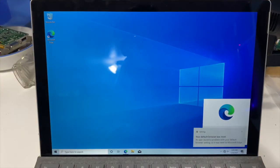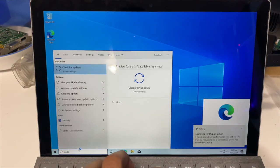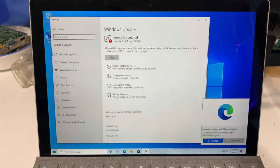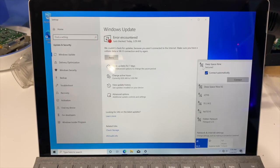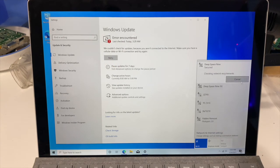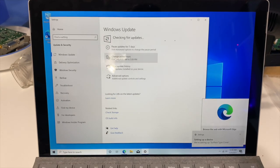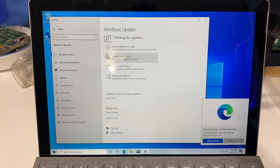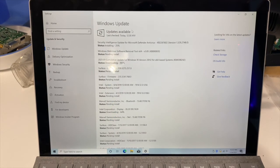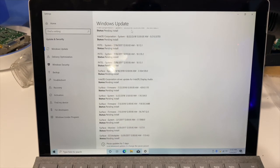All right, we're on the desktop now — we need to install all the drivers because everything will be really slow. Open Windows Update and let it scan for all the Surface drivers. Oh, I forgot to connect to Wi-Fi first — but already you can tell it's pretty fast for something running off a flash drive SSD. Let it retry. This is all the updates it has to install — all the drivers for all the Surface components. When it's done it should work really fast.